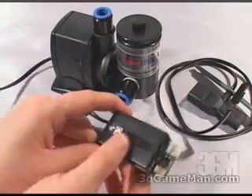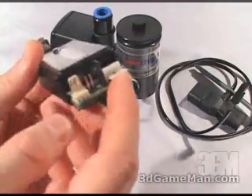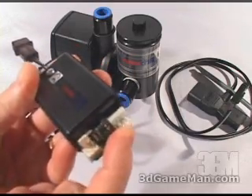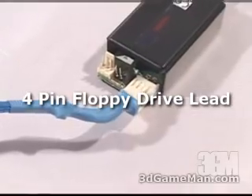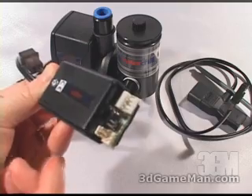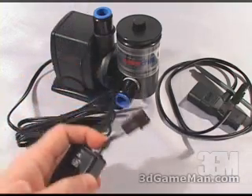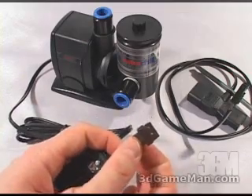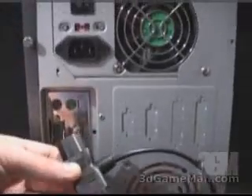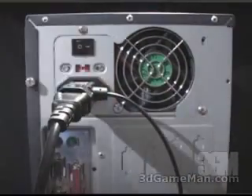There is also a control unit which is hardwired to the pump. It has a number of connections — this is where you would connect it to the power supply on the inside of the case. You can also adjust the speed on the fan with a jumper: 12 volt or 7 volt. There's also an external power connection from here, going through the expansion slot at the back of your case to the power supply.